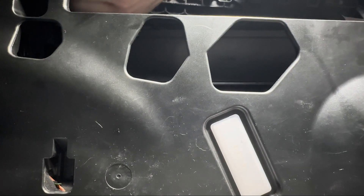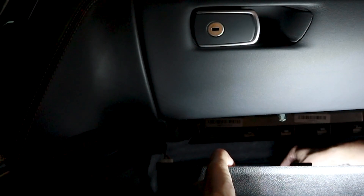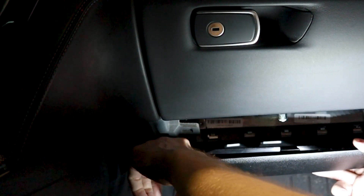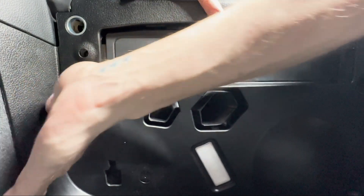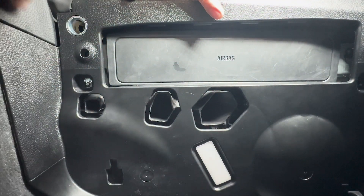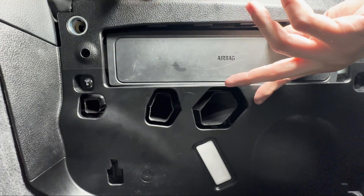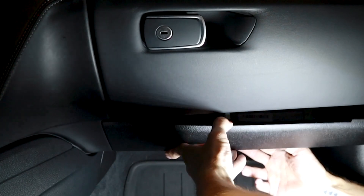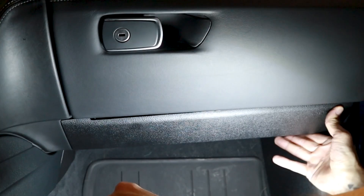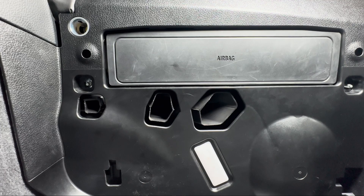Plug that 12-volt right back in here — it can only go one way, so you can't mess that up. Your bottom leg gets plugged in back here. Notice that for your 12-volt, this will tuck back behind this piece here. When getting this back in place, you want to start in this back left corner, kind of get this part seated underneath here, and then feel it around back and forth so it's getting into position. You'll see the clip on this side line up — that's when you know you're headed in the right direction. Snap the middle part in, everything's back in place. Now just retighten your 10 mils and you're done.